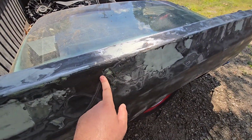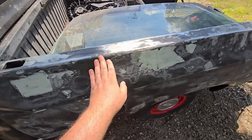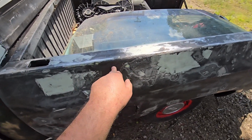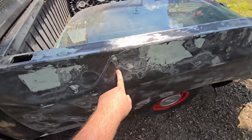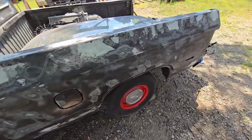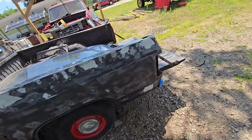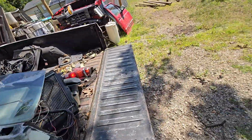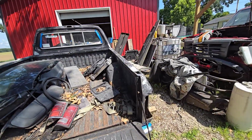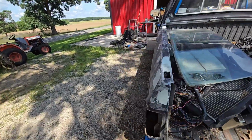But this is where this paint was peeling because it was chipped and lifted at the edges. So you have to get that, because your paint's not going to stick to this if this isn't sticking to this. So you can level that if you want to. You can feather that Bondo as much as you want to. You can get that as smooth as you want to, and that's going to affect your final outcome. For what is very much still going to be a farm truck, a going to town truck, its bed rails all knocked down.